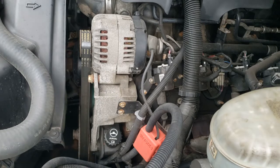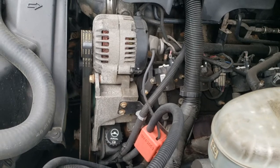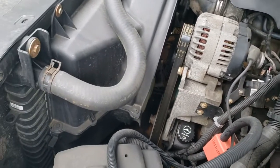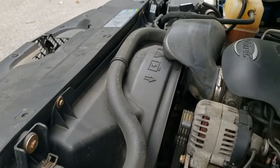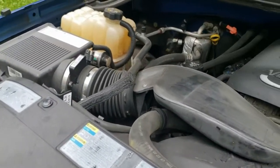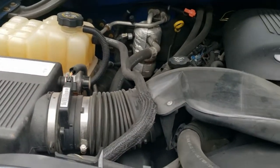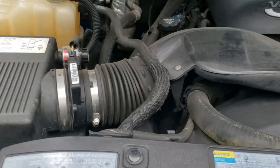Make sure that's locked in — if you start the vehicle with that loose, it will spew fluid everywhere, so that's one thing to be careful of. Moving right along, this here is called a radiator hose — that's part of the cooling system. I always take a look at it to make sure it's not cracked or doesn't have any abrasions. If it starts to get scuffed up, it can potentially blow off and you would lose the antifreeze in the motor.